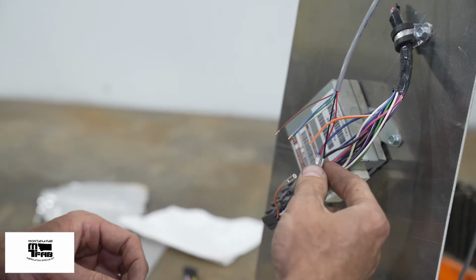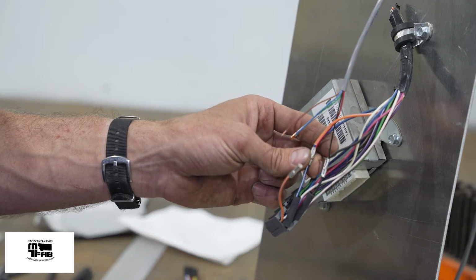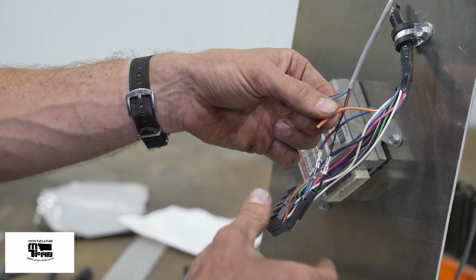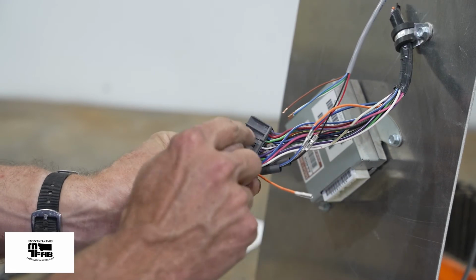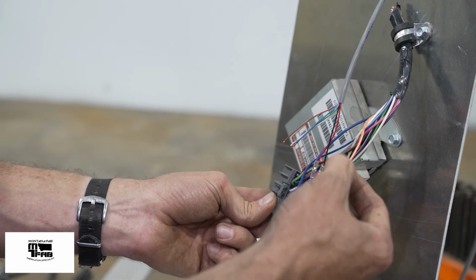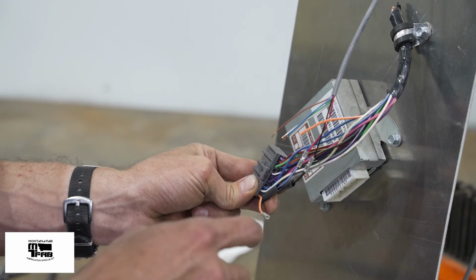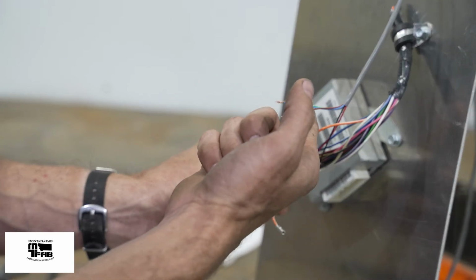Okay, now that we have spliced in the power and ground connections where all 3 wires connect to the same node, we're going to move to the solenoid. I've already cut the orange wire and spliced 1 connector to the computer side. Now, it's important to remember, after I've cut this wire, this side connected to the connector is the computer side. The other orange and white wire is in the wiring harness, and that is the vehicle side. That's the nomenclature that we use in our instructions to differentiate the 2 different sides for our gray wire umbilical.